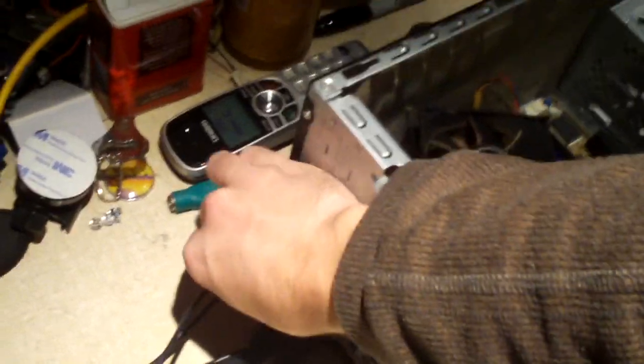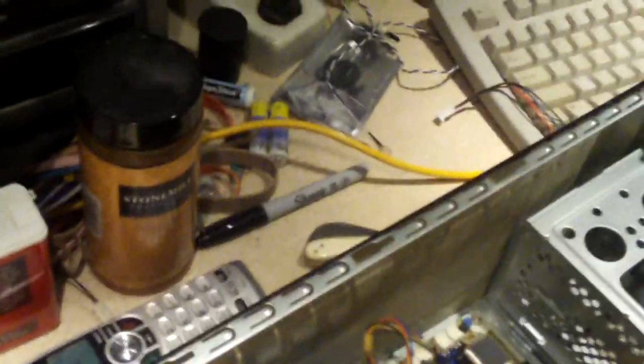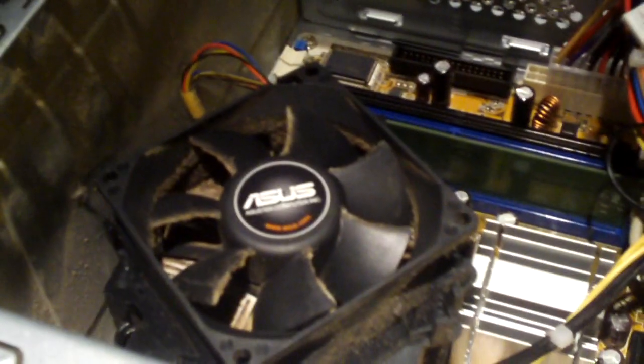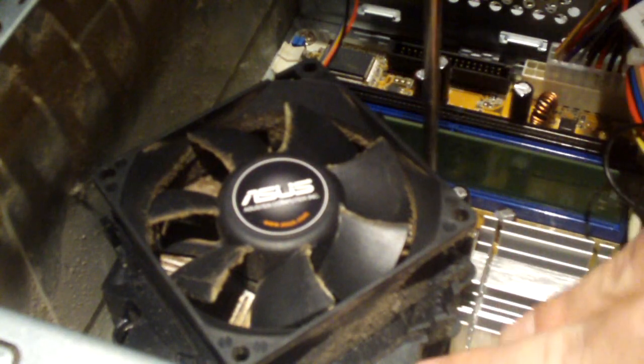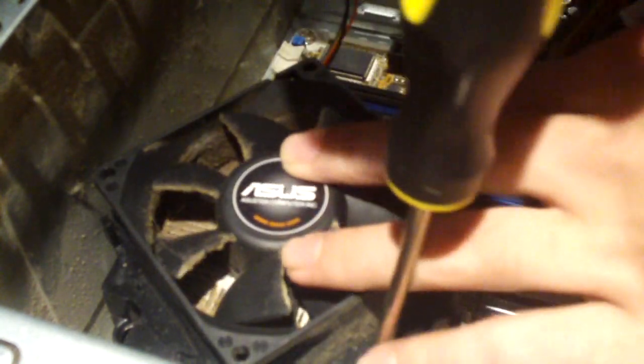Obviously it's not AMD because the board's been replaced. But you know what's really funny is I seriously believe I may have seen this system get sold by ComputerWorks within the past year. I think somebody bought it and then they redonated it or something. I don't know for sure, but anyways, let's go ahead and take that heatsink off and see what kind of processor's on this board. Never know what we have here. It could be a Celeron D, hopefully not, or hopefully a Core 2 Duo or a Pentium dual core. Something half decent. Though the only downside is I have a bunch of AMD boards, but pretty much not any Intel boards, at least for 775, that support these newer processors.